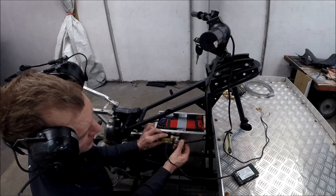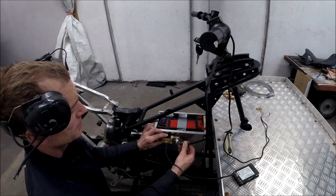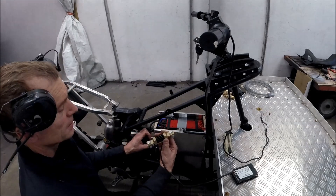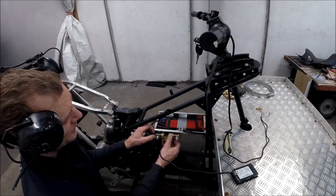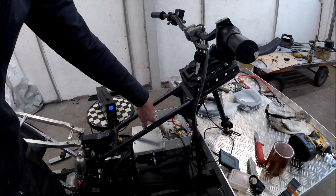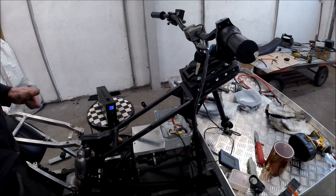I also have a wire going to the negative side of the controller. I can drill some fixing points for the cable and for the shunt. Now I have the main contactor in position and have also fitted the pre-charge resistor. I've connected the wire for charging, so I'm going to try to see if I can get it charging.